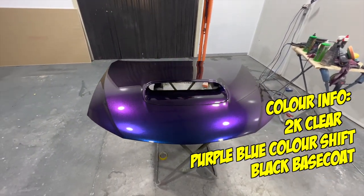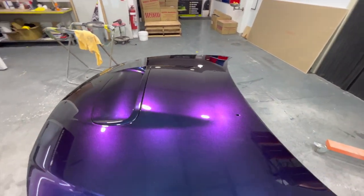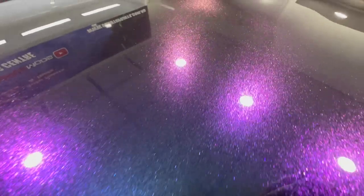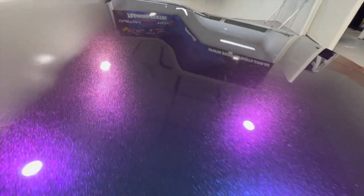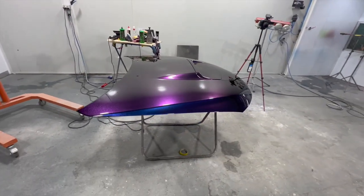In summary, the DA machine can remove 1500 grit scratch marks in a safe and easy way, but if you get a little bit better with the machine and go to a rotary, you can get the job done twice as fast. I used my machine polisher, polished all the scratches out, then went over it with a soft pad and I can't see any of those sandpaper scratches.